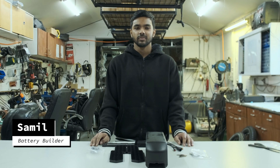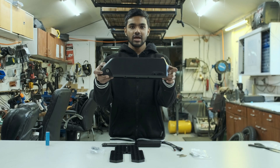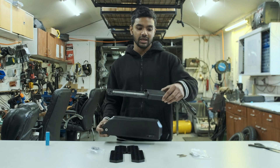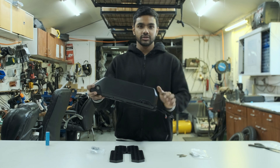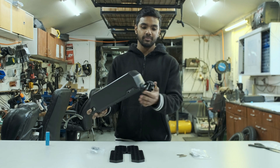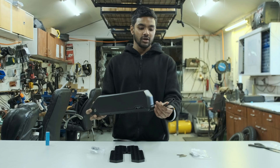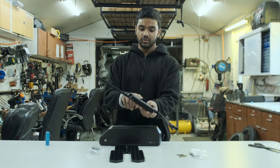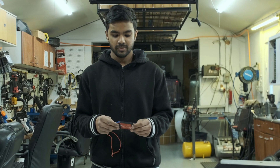Welcome back to the Electric Bike Laboratory. Today we're going to be building a 48 volt 15 amp hour downtube battery in a 4C case. The neat part about this battery is that it can be paired with a controller base — this is a KT 22 amp controller — and the controller base mounts right onto the battery. All your controller components are in the base itself, so you can plug in your harness, motor, PAS, and lights, and the battery slides in for a sleek, stealthy look.